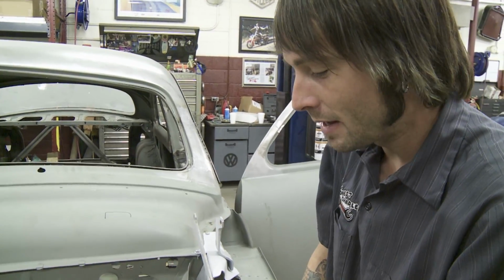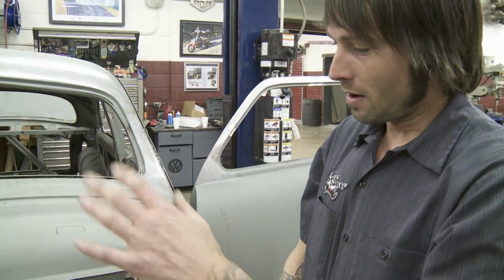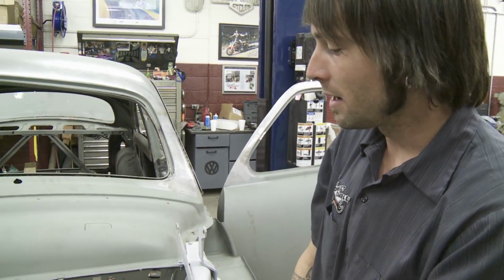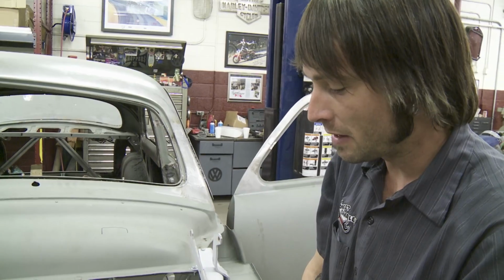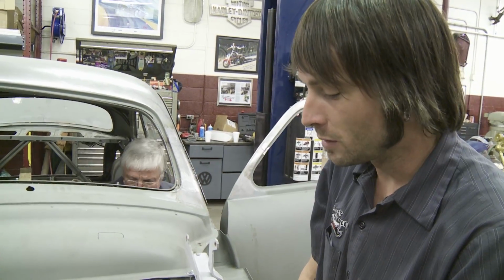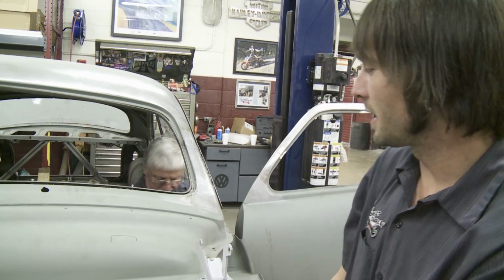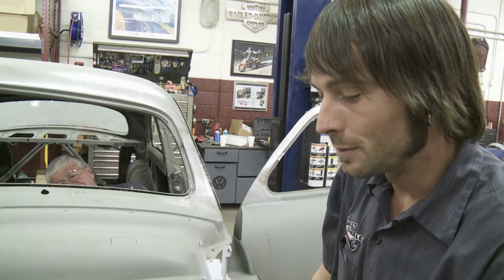This morning we came in to set the powertrain in this car. Rich and Delton already had a lot of it buttoned up, had a firewall cut out, the floorboard cut out, and we had a little clearance issue with the turbos and exhaust manifold, so we're gonna let Richard and Delton show off some of their skills on making some custom manifolds probably to give us enough clearance for a steering column. So we got the motor set, all of our angles right, and she's ready to go.